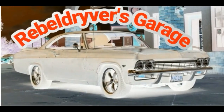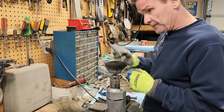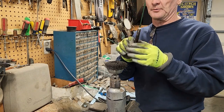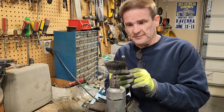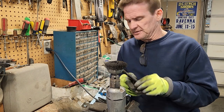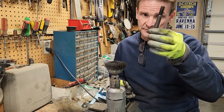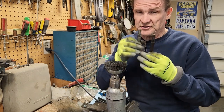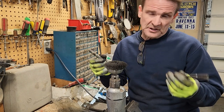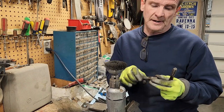So we got the head bolts here. I'm not sure — I got two or three sets of head bolts. I took the set that's the cleanest. Fords — these 428s — have 10 head bolts: 5 per head that are this long and 5 per head that are this long, so it's a total of 20 bolts. If you're doing Chevys, there are a lot more — small block Chevy is 16, big block Chevy is 17, something like that.